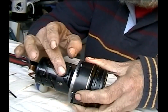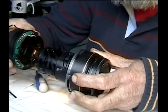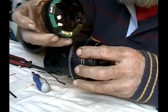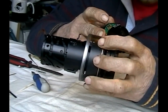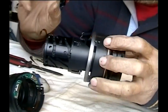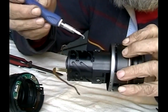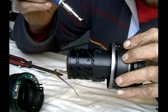I've got the arm here connected — this will fit to this piece right here, come down and align with these fingers which will control this front lens as it shifts. Then this will also connect with the tabs on the inside so that as it rotates out here it'll rotate this. One thing I just realized I had forgotten: there are nine little screws that need to go in between these black plastic spacing pins to hold them in place — don't forget that like I almost did.